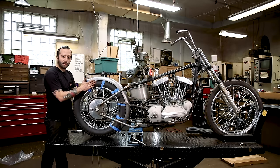You have a nice crisp line to figure out the placement from one hole to the next, because if you try to just eyeball from the center of the center, sometimes you can get it pretty close, but you're just kind of floating out in this space. But if you move it over, it doesn't matter which edge, you could go from this edge to that edge, but if it's the same size hole, it's real easy. You just move it over to whichever edge and then measure to the same edge on the next hole, and then it'll give you a really good measurement of how far apart they are from center to center.